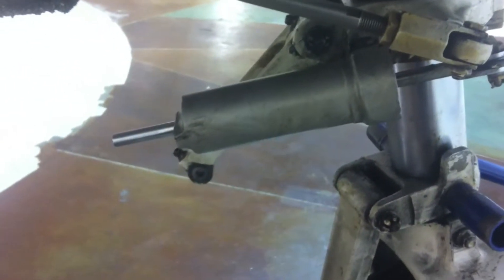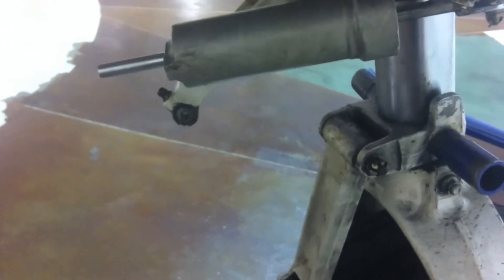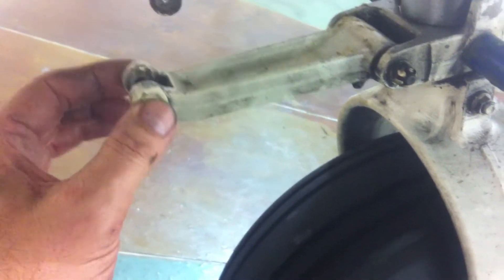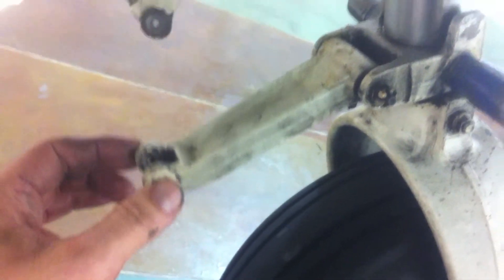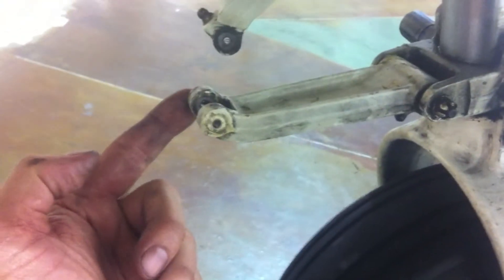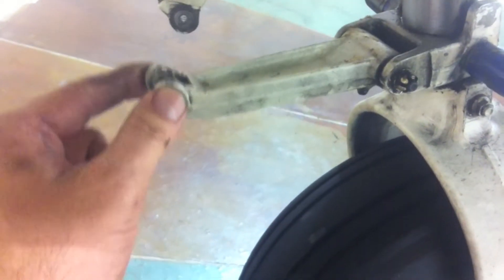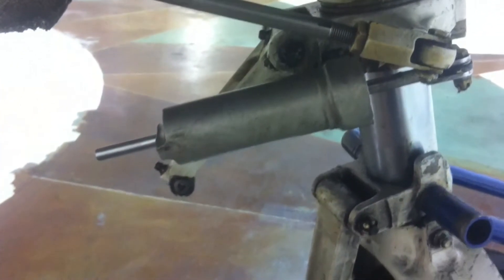Although the dampener might not be doing as good a job as a rebuilt or new dampener might, the tolerances on these parts are almost excessive. So we're going to keep disassembling it and re-bush to see if we can tighten that up a little bit, and see if that stops the problem in addition to all the other things.